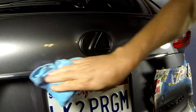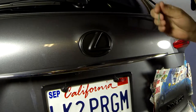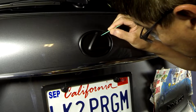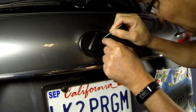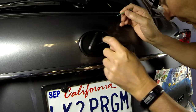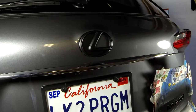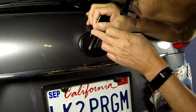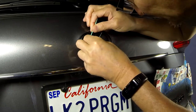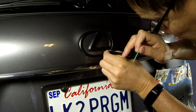There — I'm doing a little bit of cleanup. There was no overspray, but that's me being me. Now we want to remove the Plasti Dip that's inside the logo. Using your toothpick, try to get a little piece peeled up on the section that you want to remove, long enough so that you can grab it with your fingers and again pull straight back — and it will naturally cut itself around the edges of the logo. A wooden toothpick should not scratch your car if you're gentle with it. Pull the Plasti Dip out and this logo is done.